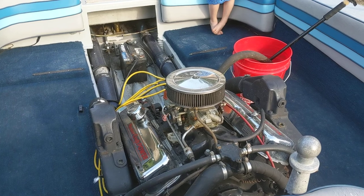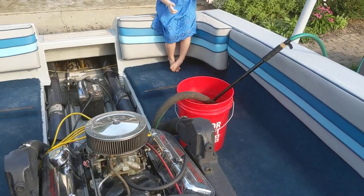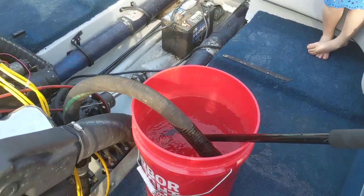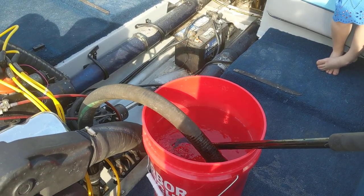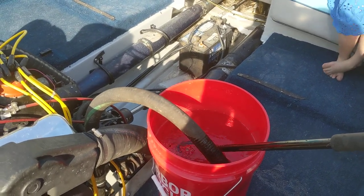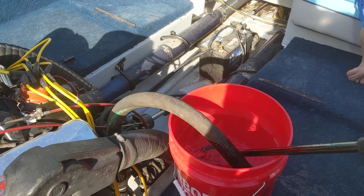As you can see, the water will rise when it's at idle. I've got the idle so low it's running pretty good. I like this setup because I can just keep that water where I can see it, and that way I know it's not running out — it's not overflowing and it's not starving of water from running it too hard for too long.